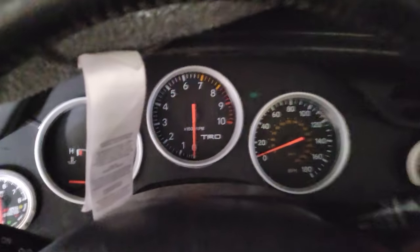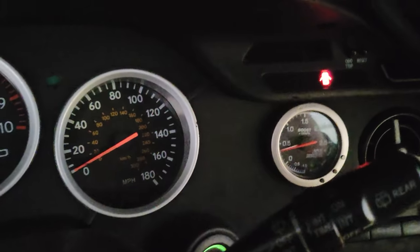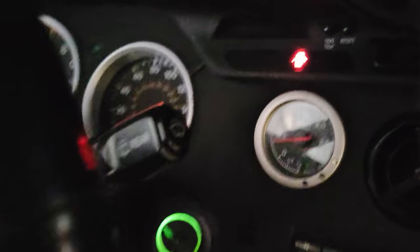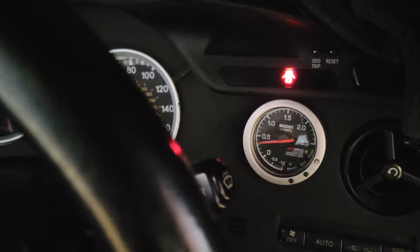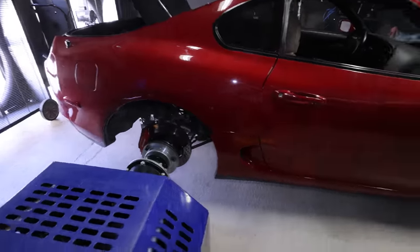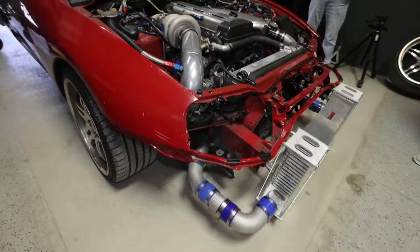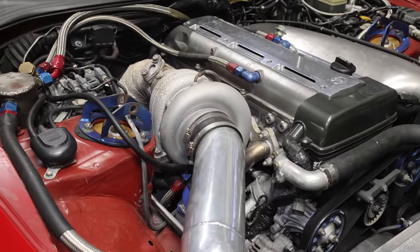What that means is that no matter what we do, it's going to stay at 4,000 RPM. In this case, our throttle is going to be our boost controller because the load is going to stay the same the whole time — that's absolutely perfect. I'm going to start with a really low boost, then do the fog machine first in the air filter and then in the inlet of the turbo, which I think is going to look really cool. Then I'm going to start cranking up the boost until it fails.